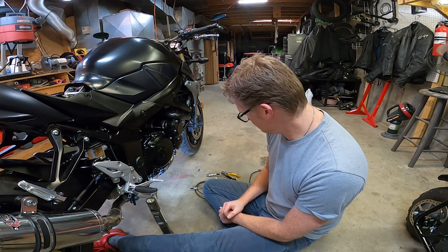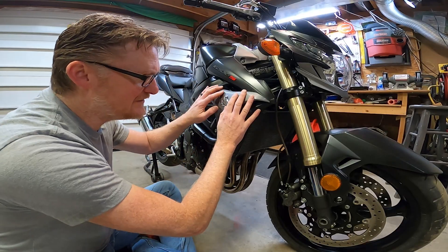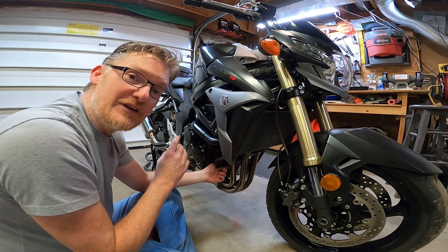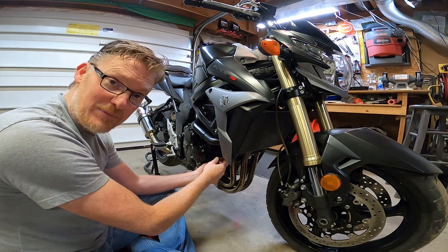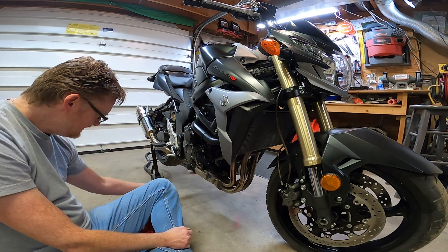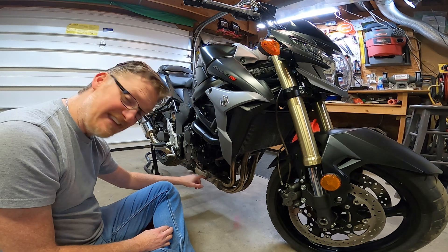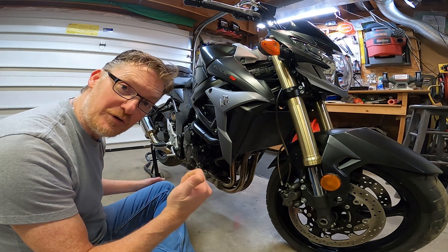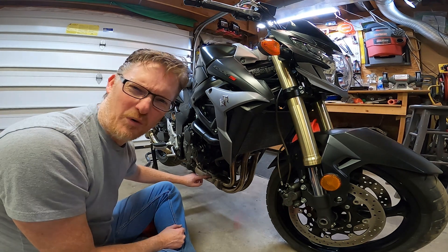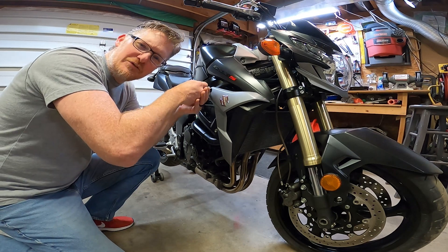The whole exhaust has to come off. My plan is to remove the radiator bolts and get it out of the way — hopefully I don't need to take any hoses off or drain radiator fluid. I should have enough play on these hoses to get it out of the way. Then I'm going to loosen up the entire exhaust system and drop the whole thing out. Once I've got it out, I'm going to put this exhaust pipe on my drill press and tap out this hole from 12 millimeter to 18 millimeter. It should work — we're going to find out.